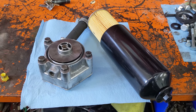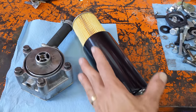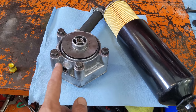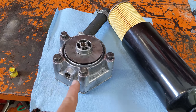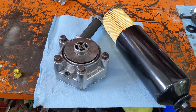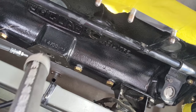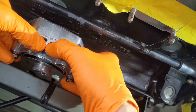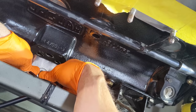Next up, I want to put the oil filter housing in. Here's the filter itself — it's just a paper element in a large cartridge. The housing has a takeoff for the sending unit; this sends electronic ticks to the gauge on the dashboard. It's a fully electronic system — kind of neat for 1961. I put a little bit of silicone on the seal there. Just want to make sure we get no leaks, because this is an area that leaks in these engines quite a lot.